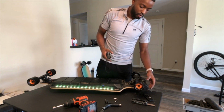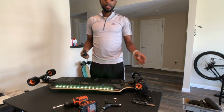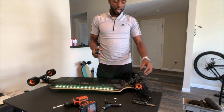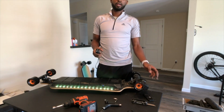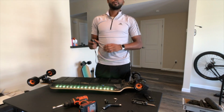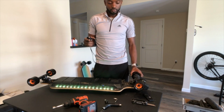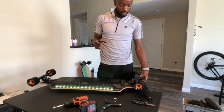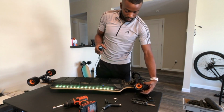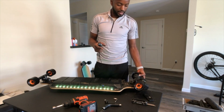You can go back through if you so choose and are more anal than I am, and get those to stop closer by adjusting the tension. I believe the one that stops the soonest is tighter. So for instance, let's see, this one stopped first, which means that the tension is a little bit tighter on that one. I'm touching it, and it's not super noticeable just by the touch.